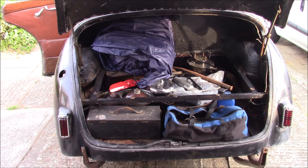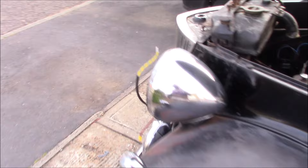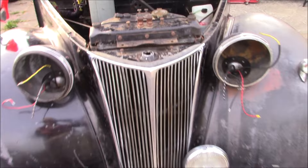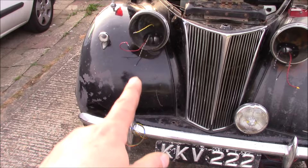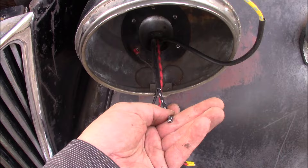But we're a lot closer, so I'm happy. Inside, the sun visor and the bumper don't really fit anywhere else, so they have to live inside at the moment. Don't worry — the battery was disconnected. Up front, I've bolted the wiper motor down but I've not connected it yet; I just wanted it in here so it's safe. It does look a little bit new compared to everything else under here, but it's not too bad. The last thing I did was run that mystery wire — the black with the white traces is actually supposed to run from this headlight, down underneath the radiator, and back up to this light, so this one can piggyback off this one. Why they chose a different colour for the wire I have no idea, because the wire that's piggybacking is red with a black trace. But that's what we've got, so that's what we'll use.